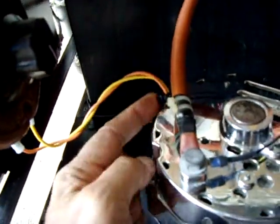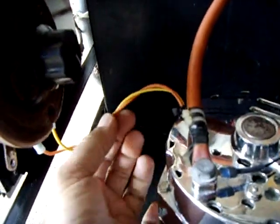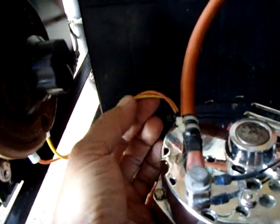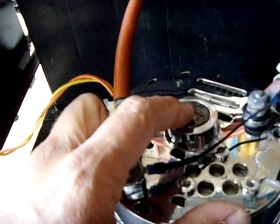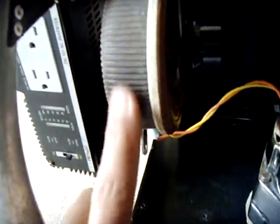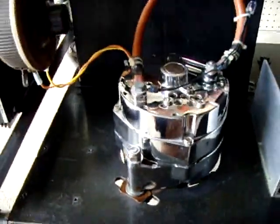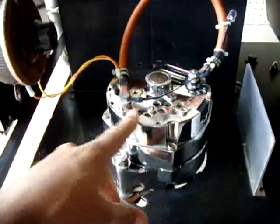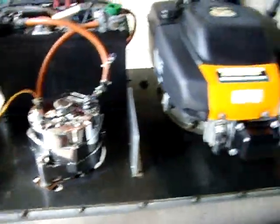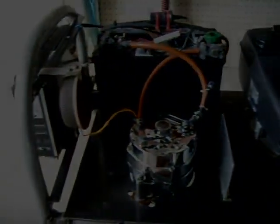The wires that feed the brush are very thin, only about 18 gauge, so I used 16-gauge wire. The wire feeding the rotor doesn't draw that much current — only about 3 or 4 amps — and this doesn't get hot in the slightest. Tested, proven, works great — full regulation over the alternator's output besides the built-in regulator.